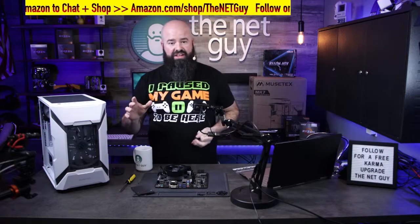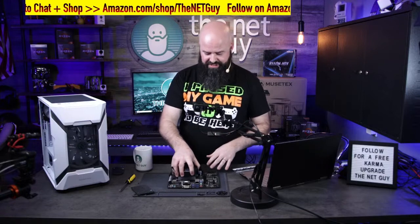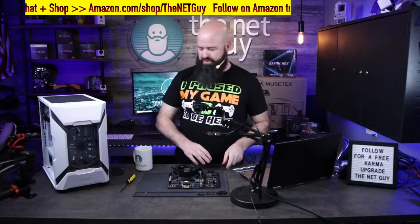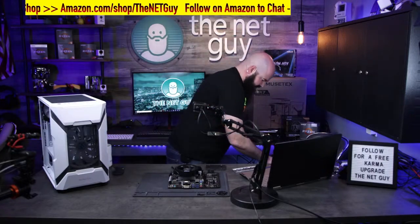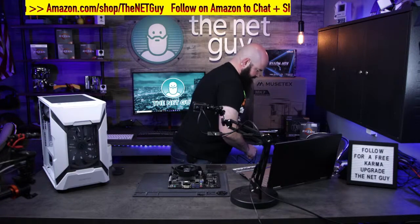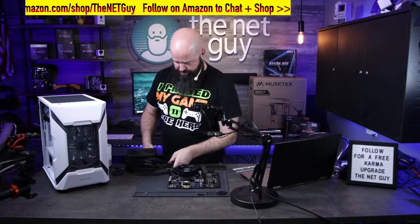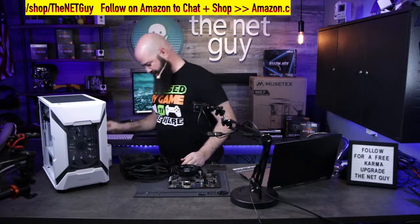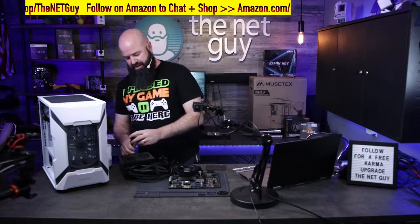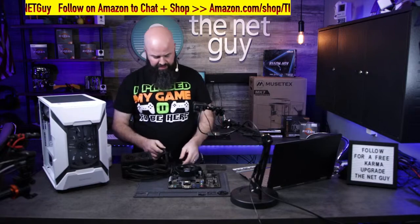We're going to do a thing that I like to do, which is to bench run the computer. So we're going to be able to boot this computer up, believe it or not, with just these components here. We're going to start the computer up and see if it runs. So I'm going to get my power supply out, and it's a good time to tag that power supply in there. This is a 450 watt power supply, so it's not going to win any awards for super high power, but it doesn't need to. And like I said, most people over spec their power supplies. They make them too strong, too big. So I highly recommend looking at a power supply calculator. There's a bunch of them online, and then finding the one that's right.